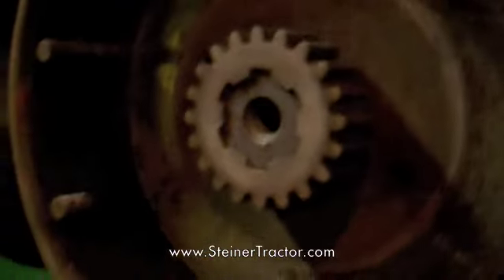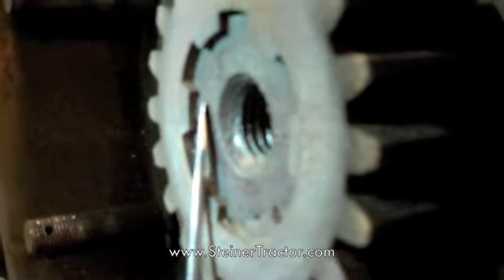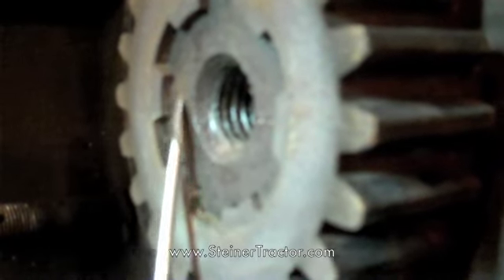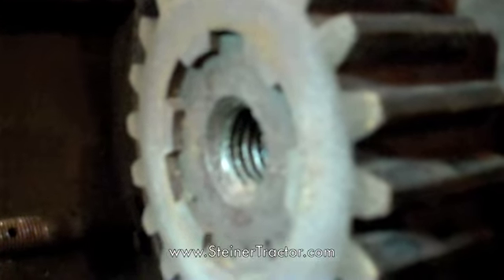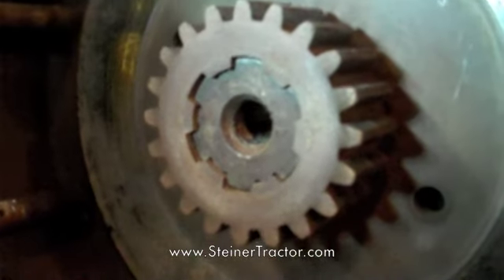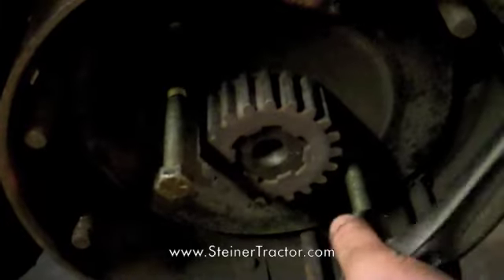When you take the washer off and the bolt off the crankshaft, observe the distance between the clutch drive disc and the end of the crankshaft — in this case it's approximately an eighth of an inch, which is good; an eighth to a quarter of an inch is acceptable. If the clutch drive face is flush with the end of the crank, it means the splines have come loose or the disc was run loose and the splines are worn. If the clutch drive is loose on your crankshaft, you're probably looking at replacing the crankshaft or seeking a vendor that offers undersized clutch drives with slightly larger splines that bite deeper into the crankshaft.